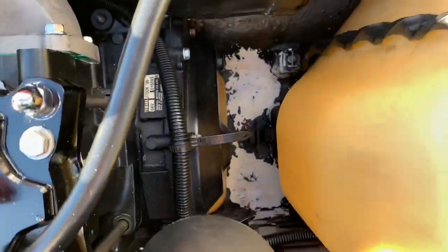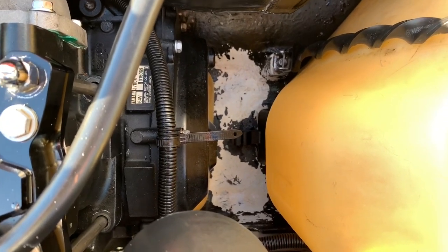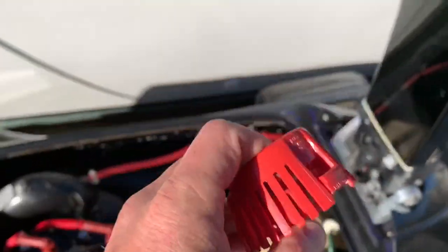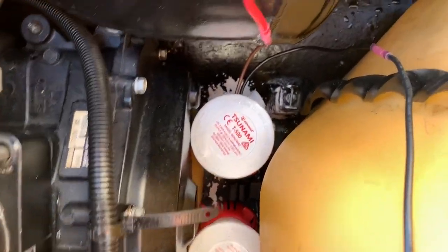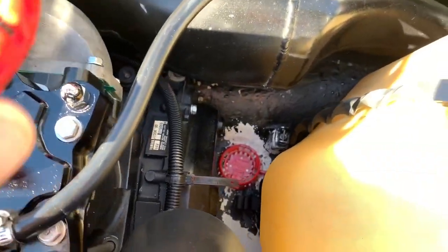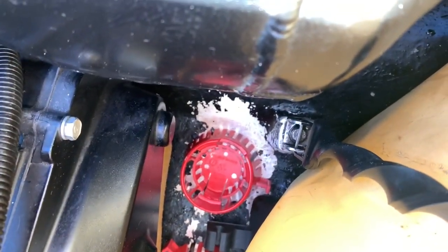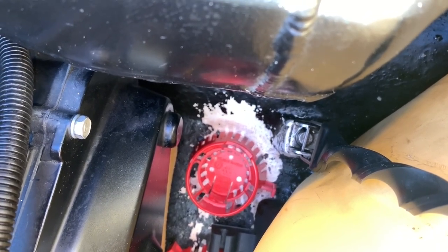The first thing I did was prep the surface — went in with 80 grit sandpaper and cleaned it up with acetone. The two bilge pumps are going to go right there. I put down some marine epoxy, and I went ahead and grinded down a part on the pumps so when it's flush you can push down and disengage. I'm double-checking my layout, placing both pumps, and just applying the marine epoxy — focused in the center. It's a two-hour set time. I used a sharpie to mark where I was going to place them, because you gotta account for where the hose comes out.